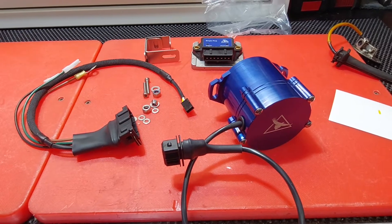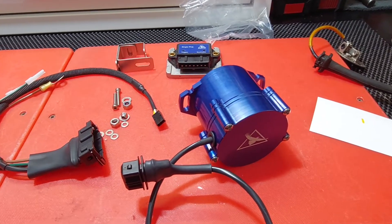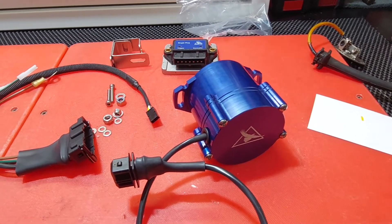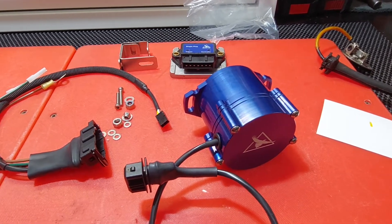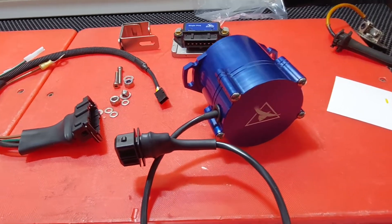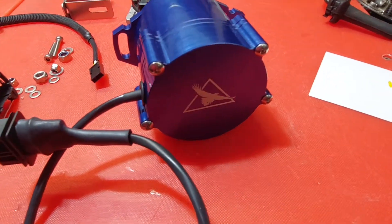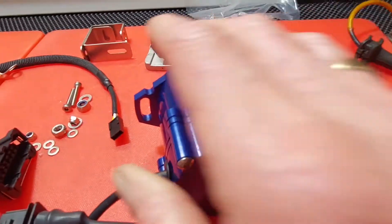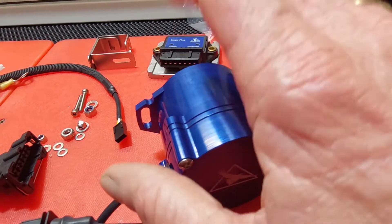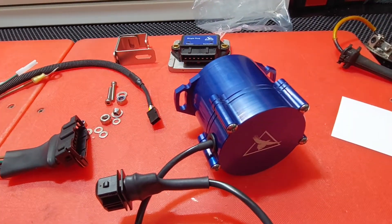So that's what you get in a points-in-a-can bike, made from the end of probably 1978 through to about June or July of 1979. No doubt someone will tell me if I'm wrong, but I'm pretty sure that's the ballpark — and you'll certainly know if you've got one because you'll have a points can like that with a rubber snorkel sticking out of it and a condenser sitting up on the front of your timing chest.